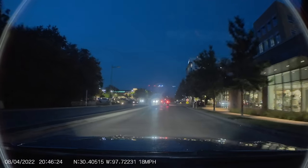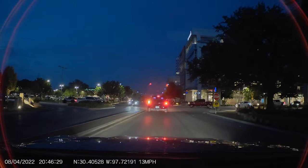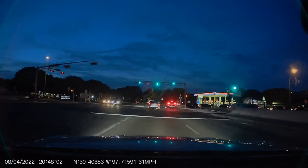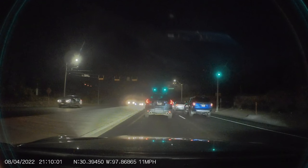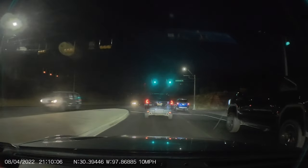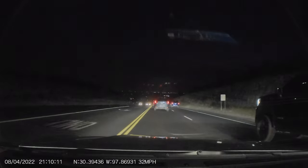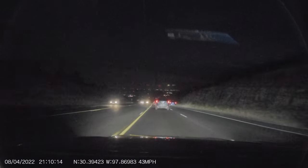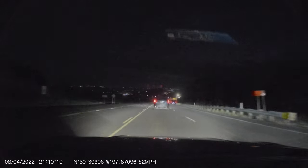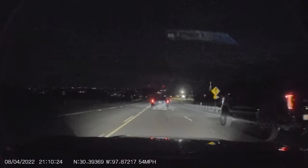The camera performs well at night too. Here's some dusk footage — it actually looks a lot brighter in the video than it did to the naked eye, so it did a good job of amplifying things. At dusk the noise is pretty acceptable. Once it gets really dark, the ISO gain noise becomes quite severe, but this is typical of any dash camera. Also keep in mind that the polarizing filter acts a little bit as a neutral density filter, so it does make the camera struggle a little more at night, giving slightly more noise in nighttime footage.